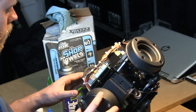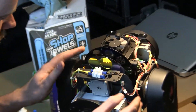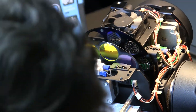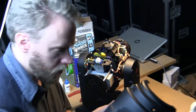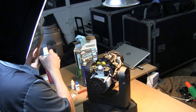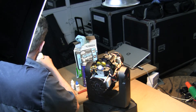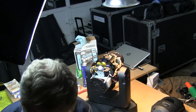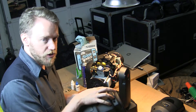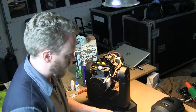Now we're going to go ahead and put the body back on, but before we close it up, go through and make sure everything is working, everything is still connected, and blow out any dust one more time. We didn't clean the body housing yet — same deal, make sure the vent ports are open and clean, blow out any excess using air. Be careful when grabbing these; if you forgot to remove the screws, it's very easy to accidentally send them flying everywhere.